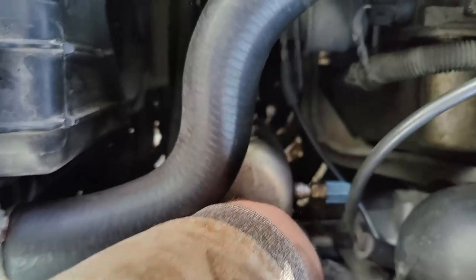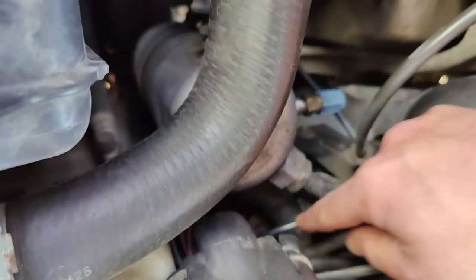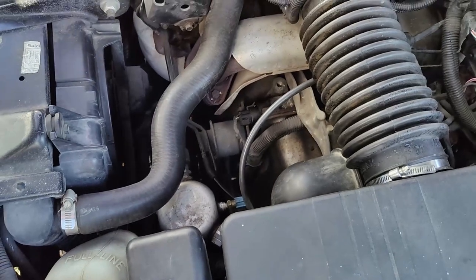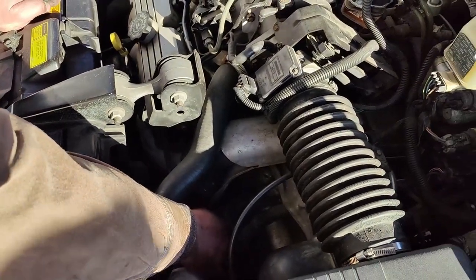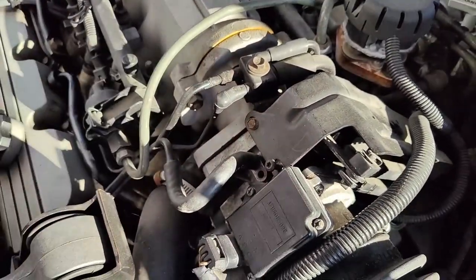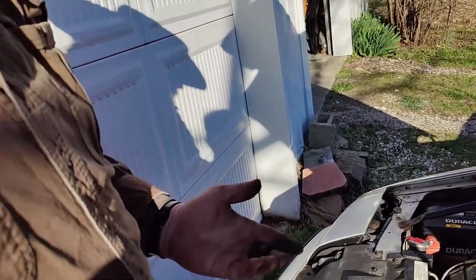So we replaced it — I cut some vacuum hose and made new connectors and reconnected that. And then the line under here, Kit was able to get to it way back under — it actually goes to the air feed for this. You can kind of see the tube there going under here. It's not the part that comes out of the fender — it's way back here underneath the air box. That's the line that actually ran there; that was the line we had to reconnect. So we've solved the vacuum leak issue on those. You'll run into that a lot on these old vehicles, especially if they have a hard line to a hard line — they use a soft connector. All these soft connectors go bad. You can see this one where someone's put silicone over it to connect it and seal it. You're going to be going through and refixing those to solve all your vacuum leaks on these older cars with a lot of vacuum.